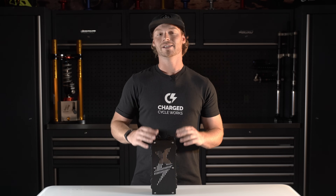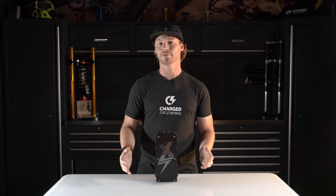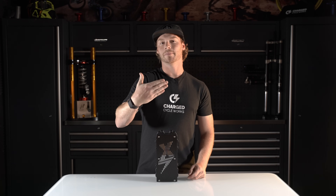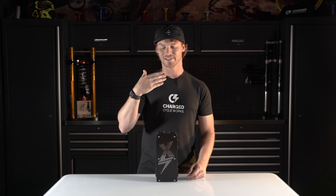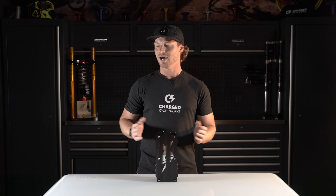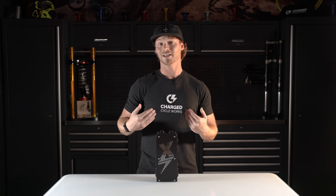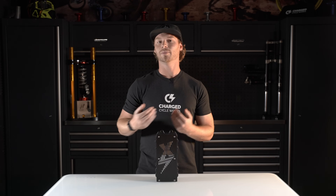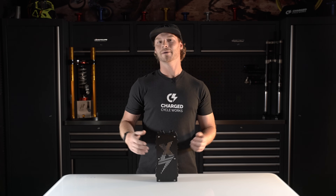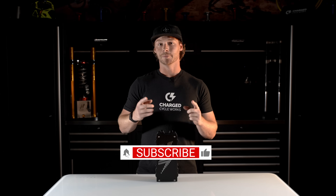For me personally, in day-to-day use, I'll probably use it for something like the whole shot in a race. I would set a timer on this — some odd 10 seconds after I start depending on the course — and launch off the line with the clutch, but set the degree angle so the bike puts the power to the ground and won't come up, giving me traction all the way through a launch. That is something I'm extremely excited to test. This can also be used in so many other ways, like climbing up a hill — set the degree angle for that hill and you can climb up it a lot easier without looping out backwards.